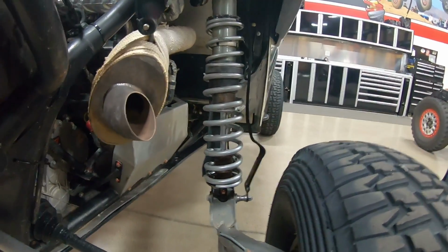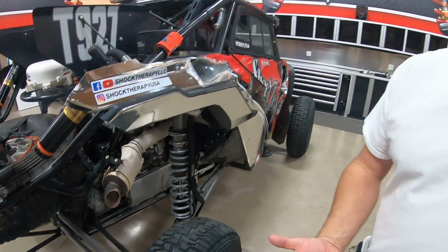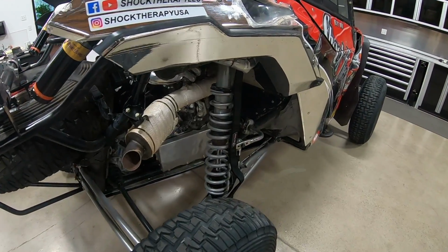Justin, we have some people talk about how they kind of help to assist the CVs. So straps also help the overall suspension and CV in that sometimes if you have the extension stop in a Walker or the coil spring break in a Fox, the extension of the shock will come out too far. Now, the factory runs this stuff fully drooped out at its maximum CV angle. So if you add another inch of extension to it, then you're gonna overextend the CVs. You can possibly pull the axle right out of the CV and pop the clip off. You can put too much angle on the CV, which will completely destroy the CV, blow up stars, blow up cages, and cut boots. So CV life is extended with straps because you know you're not gonna have an overextension.